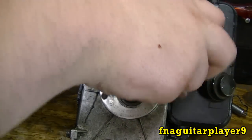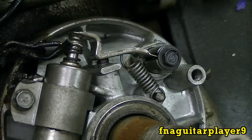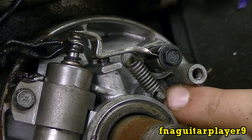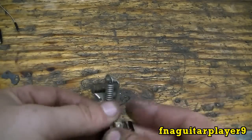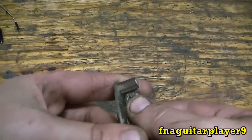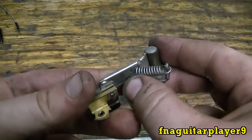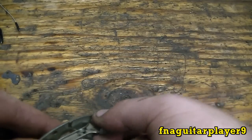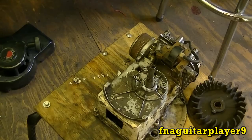Once you get everything set, go ahead and put your cover back on — this just keeps dirt from getting in there. Then get ready to put your flywheel back on. One thing I forgot to mention: your spring hooks down inside and comes down here to hook on this little peg. This screw is what holds the points together. There's a little slot right there — it just slides in. That's how it pivots, almost like a hinge. You can see how your spring hooks into it.